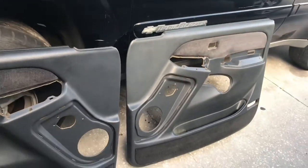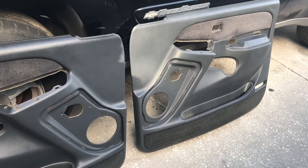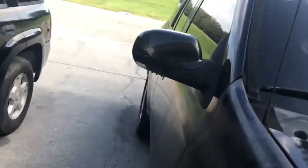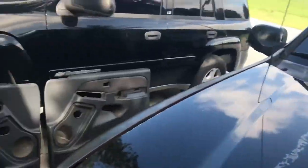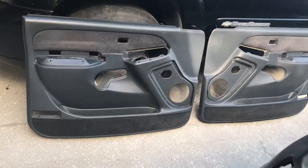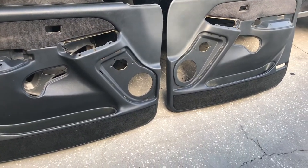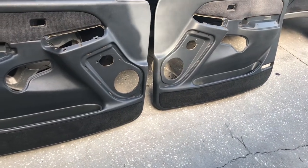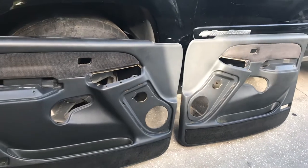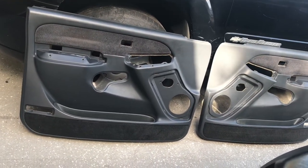But let's get back into the video right now. Next, we're letting these guys dry up real quick, then we're gonna throw the tape on them, making sure we mask them up pretty good. Depending on how the weather looks, the hot point gets over here around 4 o'clock, so if I can fiberglass these at 4, let them sit overnight, acetone wash them in the morning, and get them sticky. Tomorrow's supposed to be a nice day. We can lay some rings, probably even have them fleeced, and if we can have them glassed by tomorrow, that would be badass. So let's get back to work.